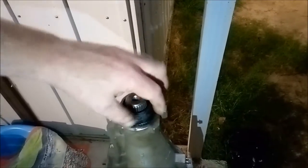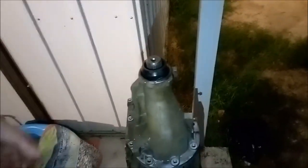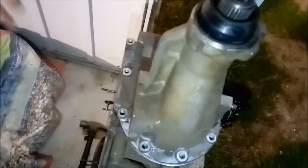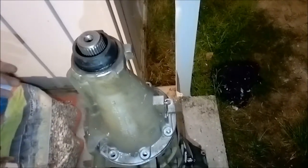The bushings may have worn the aluminum so badly that they've warped or stretched the case — just like they did to my tail shaft, where I can now almost slide the sleeve in with a rubber hammer when normally you'd have to destroy them to get them out. I had to order a new tail shaft because of this problem. These people cost me more money and headache with their cheap repair. For $3,200, I basically got a torque converter and probably generic Dexron/Mercon fluid out of a 55-gallon drum — and some bolts tightened that I could have done myself. Once I pull mine out and confirm what I know, I'm going to name the shop in the next video.